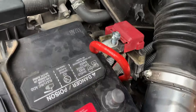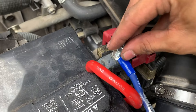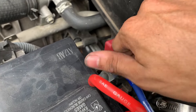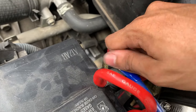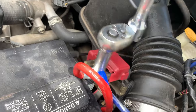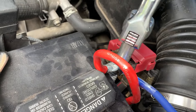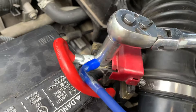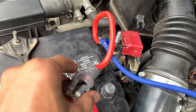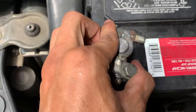Last thing to do is connect to the battery. We remove the nut, connect the amplifier wires, make sure they're in there, and put the nut back on. We tighten it down with the ratchet — the amplifier wires are now connected. Now we can connect the battery — positive to positive, negative to negative. No sparks — that's a good sign.